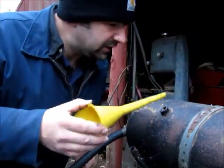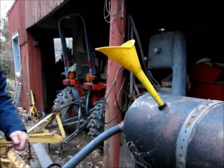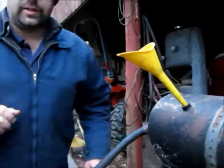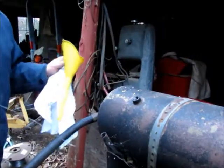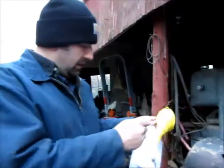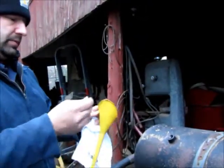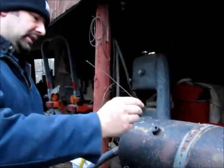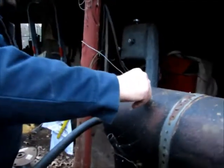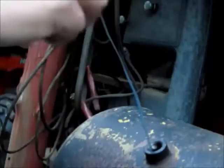I'm going to look down in here and see if I can see any fluid level. I can't see it, so I'm going to find something to use as a dipstick. What I got was a little piece of fence wire. I'll wipe it off clean with a rag, stick it down in there, mark the level — it's about right here, so I've got a little ways to go. Let's keep adding some.